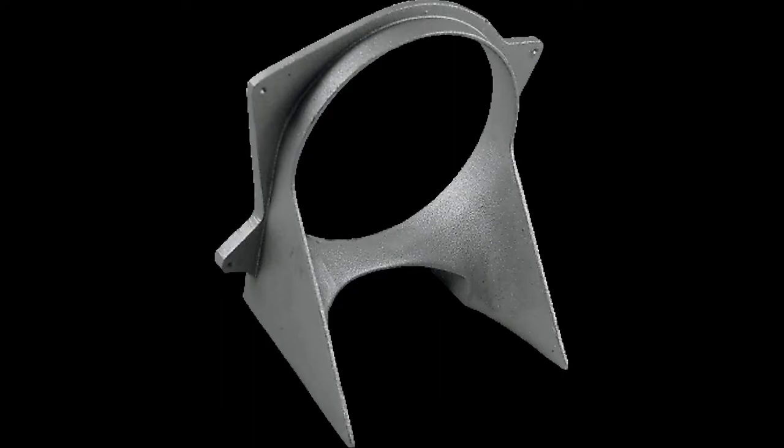One thing that I found out when installing the pump is the pump actually just has these really small self-tapping screws, and they just puncture right into your very, very thin hull and let water through. I think that it's a huge engineering mistake, and I think everybody's ski is letting water in through the pump shoe's screw holes. So when you're installing pumps, either A, use a ton of 5200 on the other side, or since you've got the hull open, I would just put bolts to latch on the pump shoe and get a nice aluminum one so it'll never break, because it'll be pretty hard to replace if you put bolts on the other side. But yeah, I would put bolts on the other side and put a glob of 5200 over that as well.